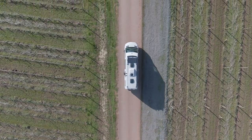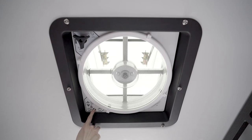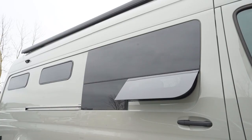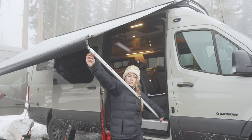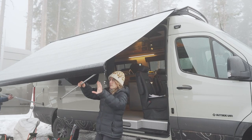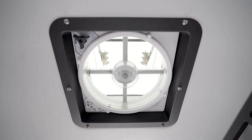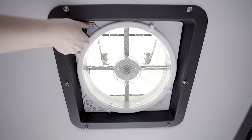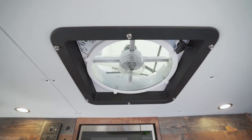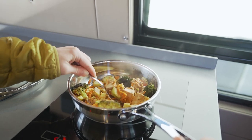If your van has two vents and you're camping in hot temperatures, we recommend running one fan on exhaust mode and one fan on intake mode, plus opening as many windows as possible. The fan on intake will pull fresh air into the van and create circulating airflow to help cool it down. To cut down on condensation on rainy, snowy, or humid nights, we recommend cracking a window and running your fan on low on exhaust mode in order to create airflow and let warmer, wetter air out. Or you can simply manually open the fan's lid to your liking. If you plan to cook in your van, we recommend installing a fan right above your kitchen area and running your fan on exhaust mode to pull smells or any smoke or steam out of your van.